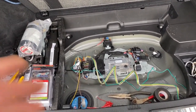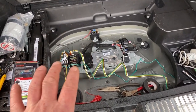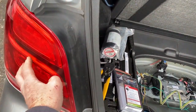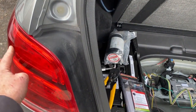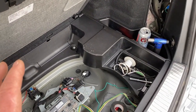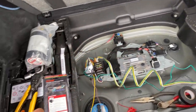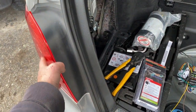It's not an easy job - it's about a two-hour job. But the elephant in the room is the wiring: what do you do with the wiring, especially if you've got the LED tail light package? This combines the turn signal and the brake light into one dual-purpose light, and because it's LED it's low voltage, low draw. If you try to wire it regularly, you can't - there are two power circuits going into here at all times.